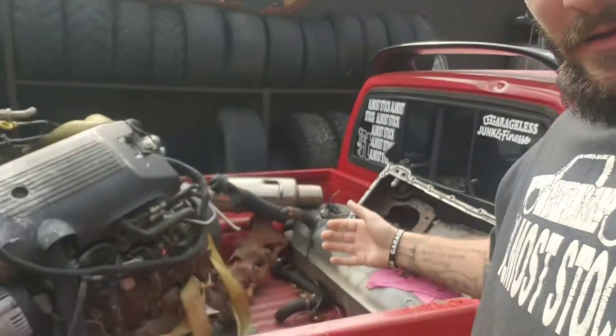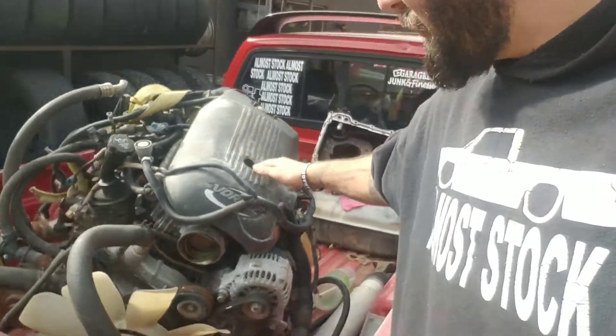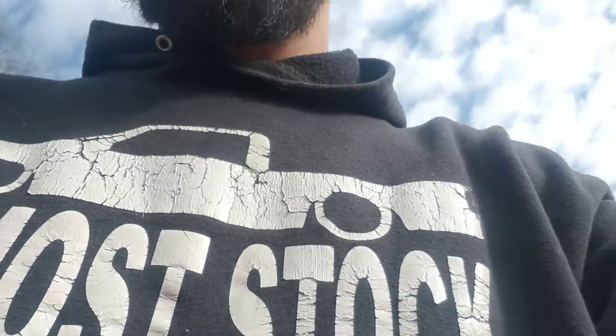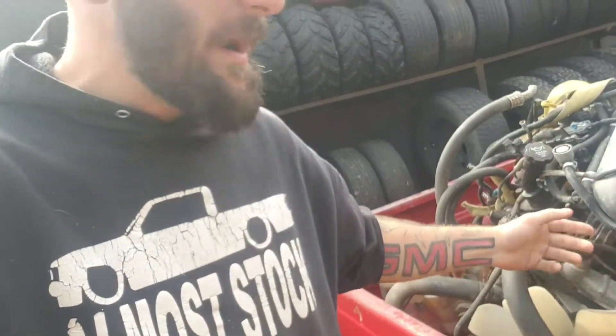Like I said, I got headers on the way and I got some more parts coming. Here's what we got for a motor — this is a 2004 5.3L with 706 heads. I was kind of hunting for those, so I'm glad I got those. I got the PCM and the wiring harness. Unfortunately this wiring harness is a green-blue plug, not a red-blue plug, which means the throttle body is drive-by-wire. So I will have to purchase a new wiring harness and throttle body — not too big a deal. It kind of saves me anyway because then I don't need to tear the wiring harness apart and make it a standalone myself. I'm going to send the PCM in to have it reflashed once everything's together so that it runs.